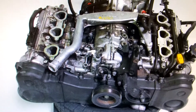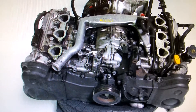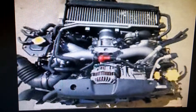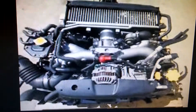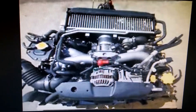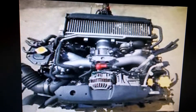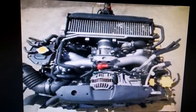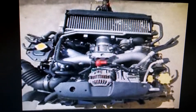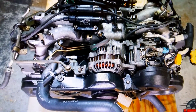Of course you're going to need to locate an engine. Do you want to go with a SVX engine? Or perhaps you want to go with the 2.5? Or maybe you want to go with the WRX engine. That's going to be a decision you're going to have to make. If you want to go with horsepower, you want to go with the WRX, and also look at the SVX. If you want to go with fuel economy, then you're going to want to perhaps go with the 2.5 or with the 2.2.